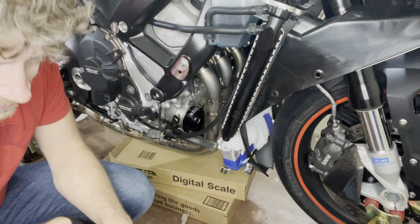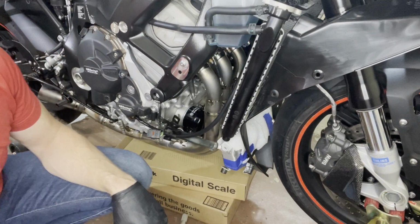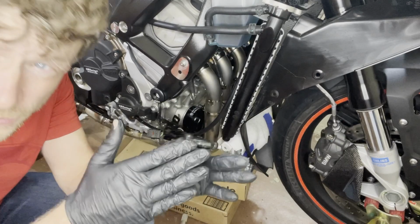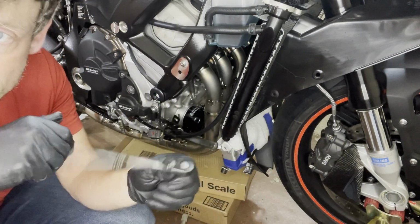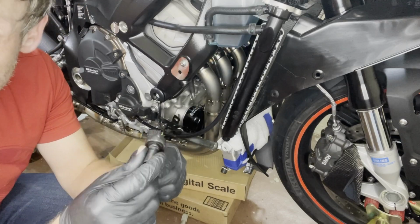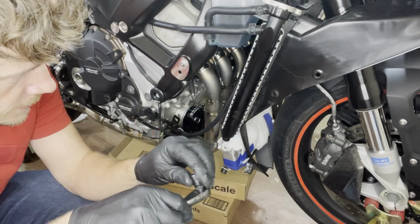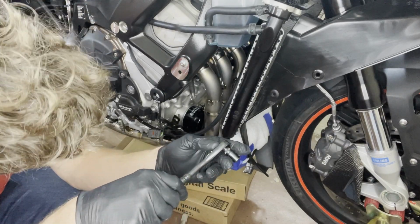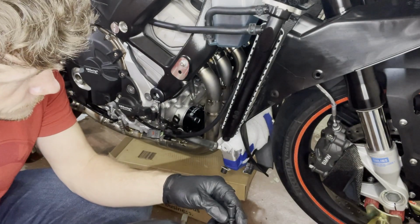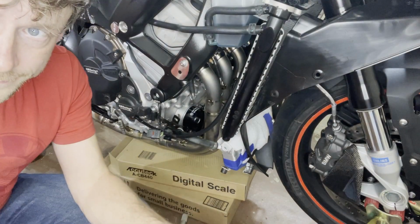All right, now that these guys are properly seated, we're gonna torque them down to 10 Newton meters. You wanna do this before you put the springs in place, because the springs are often right over the socket. Also, you might not be able to reach with this one. You might need some adapters, some flexible pieces so you can articulate this tool and so on and torque it down. Anyway, I'm gonna try doing that right now.